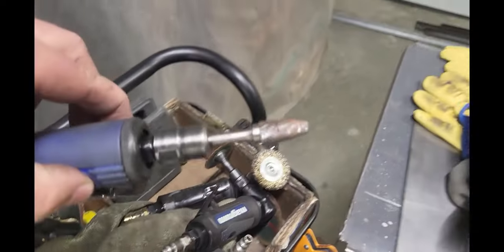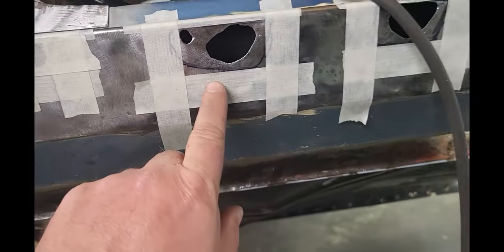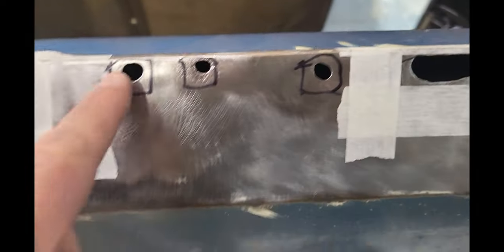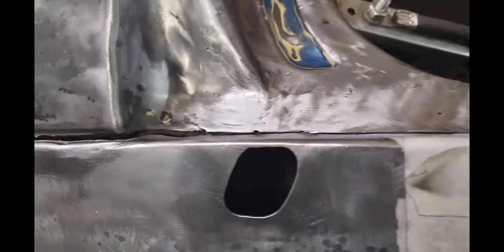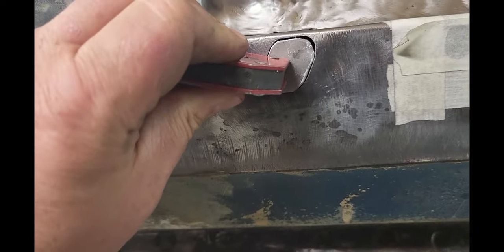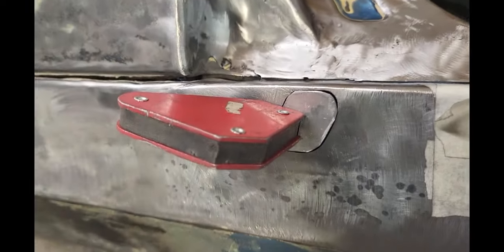I wallowed that hole out with a carbide burr — this little guy works really good for making holes in steel. What's your guys's opinion: how much pitting is too much pitting whenever you're doing rust repair? Do you just go ahead and open that up and make a bigger patch, or do you just deal with it? I'll probably end up cutting that out because it's just going to lead to future rust. Cut a little piece to go in there. Pro tip: mark it on the back side so you know the orientation whenever you're doing these odd-shaped patches, because if you try to put it in the wrong way it almost fits but you'll end up cutting it down and it won't go in properly.